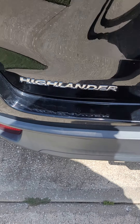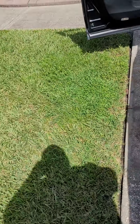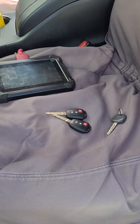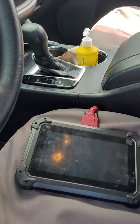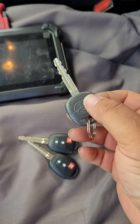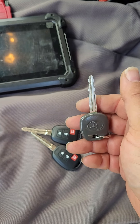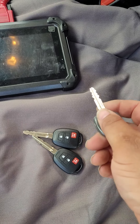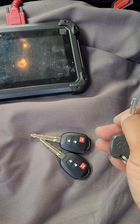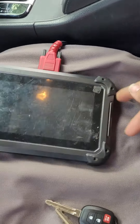We've covered the license plate for the customer's security. Today we are doing an add-on key process, but the customer only has a gray valet key. As you all know, with valet keys you cannot do an add-on process because you need a master key for that, so we're going to have to do a loss key process. Today we're working with the Autopad Pro Light.